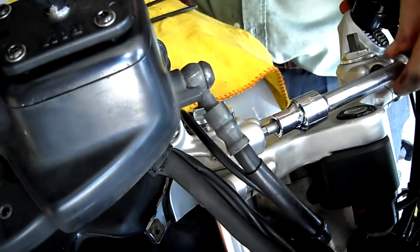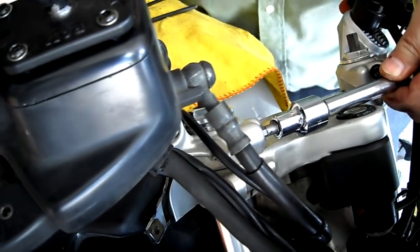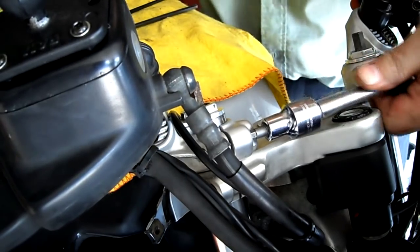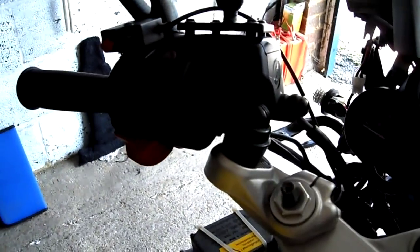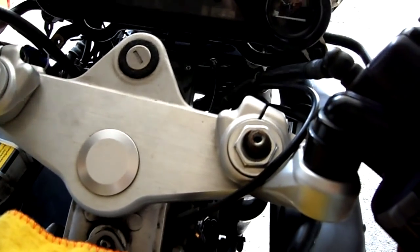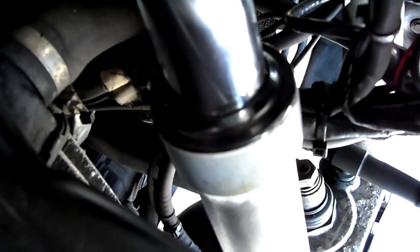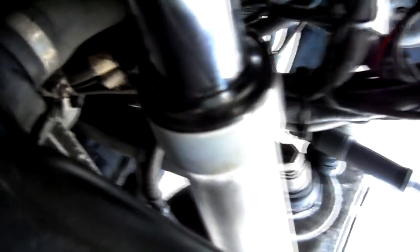Make sure you go round and recheck all the torques of the six screws you've taken out — that's the two handlebar screws and the two yoke screws on the edge. Pat yourself on the back, job well done, and think of the money you've saved. The total time for the job including taking the fairings off and putting them back on is roughly about two hours, that's if you're quite adept at taking the fairings off. At the end of it you've got two nice new seals.